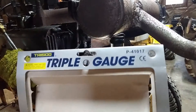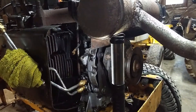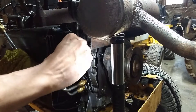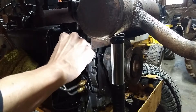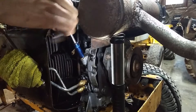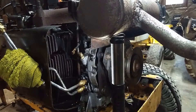Pretty sweet — 18 bucks. Gives you an ammeter, an oil pressure gauge (zero to 60 PSI), and a water temp gauge. I'm not sure what I'll do with the water temp gauge — I have some ideas. I've already prepped the 1/8 NPT fitting with a little pipe thread sealant and screwed it down in there. It's a brass fitting with a 7/16 hex on it going into the block. You don't want to snug it too much, just enough to seal it up.